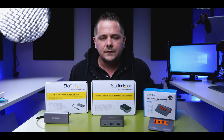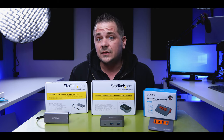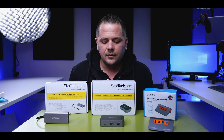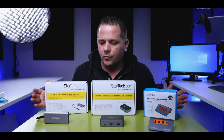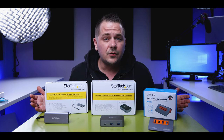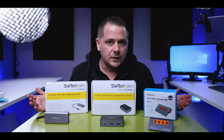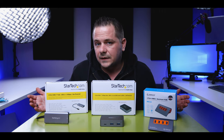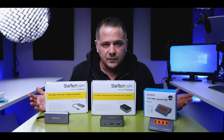To put it in perspective: when you're cutting and pasting — moving the whole file instead of copying — you're getting full throttle speed. Running with these, you're getting up to 790 megabytes per second on that USB 3.1 Gen 2. If you are copying, you're losing about 20 megabytes per second on that — that's copying from your SSD to the computer. When you're writing to your SSD, you're getting around 625 megabytes per second. They all averaged around the same. If you're copying, you'll drop down another 10 to 15 megabytes per second.